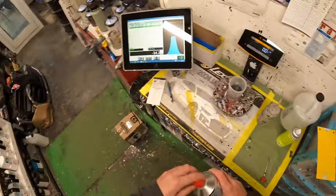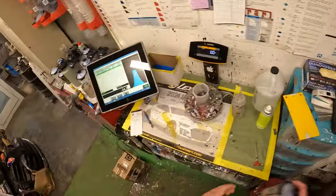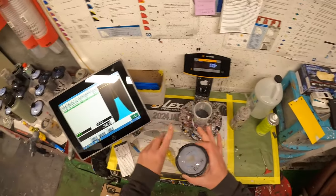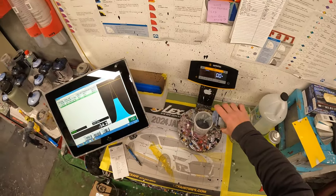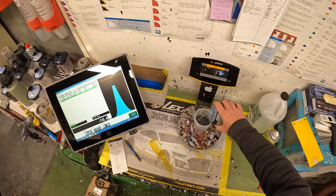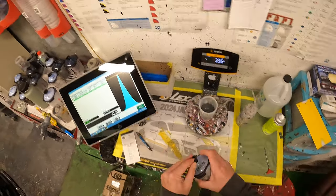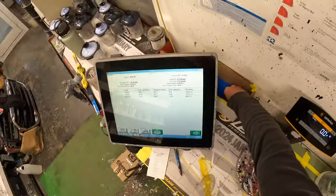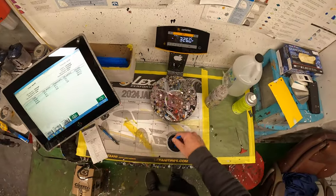Since blue is so transparent, if you spray the same color, same mixture on a different shade of gray, it's gonna look different to you. To everybody, not just you. That's why it's important to have the same undercoat on all the panels.